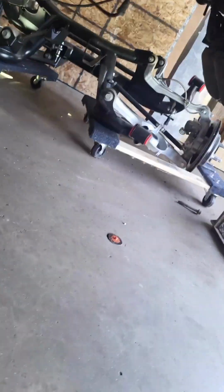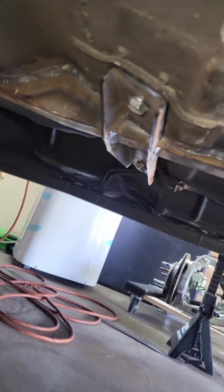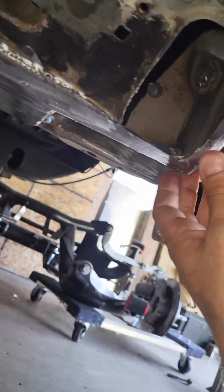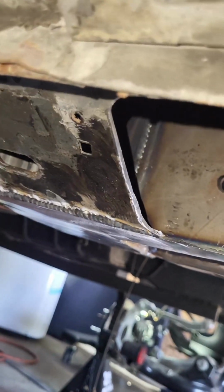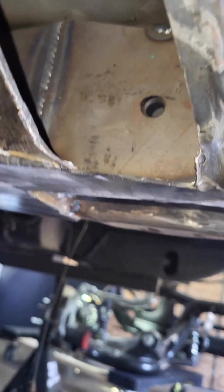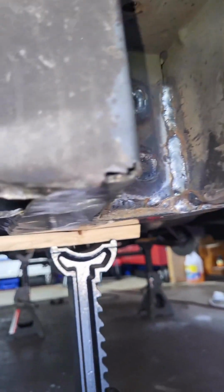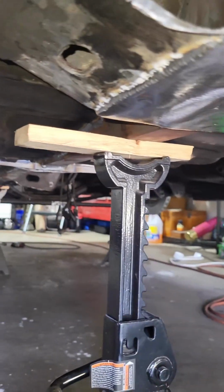Go underneath. Seat brace in there, goes all the way up to the front. What I like about the Detroit Speed connectors is this: it actually has a doubler plate that goes through and doubles up on your lower torque box, which, you know, then makes the suspension react on the whole subframe like it's a full frame vehicle.